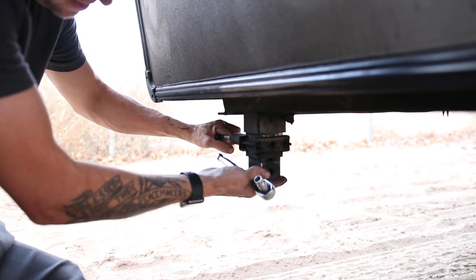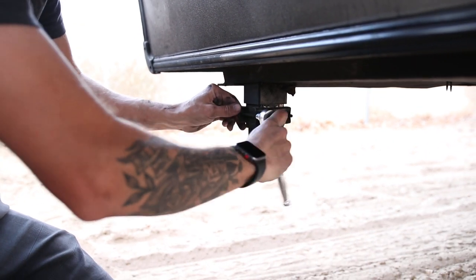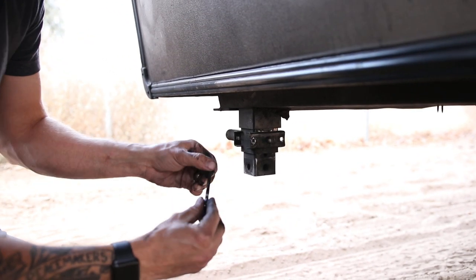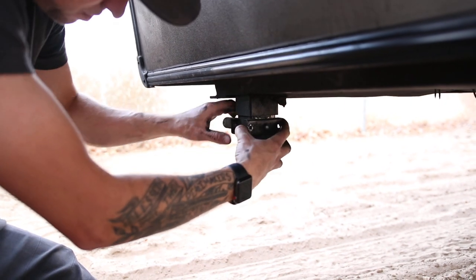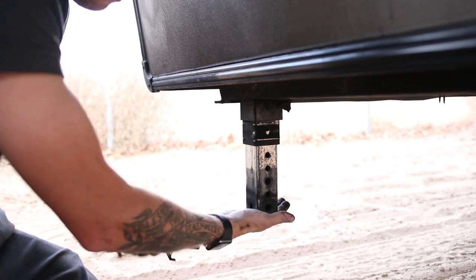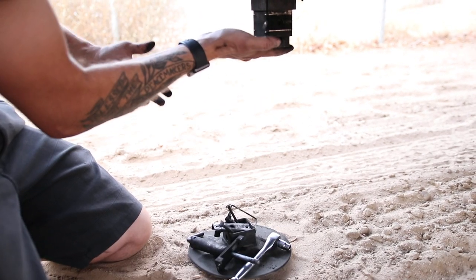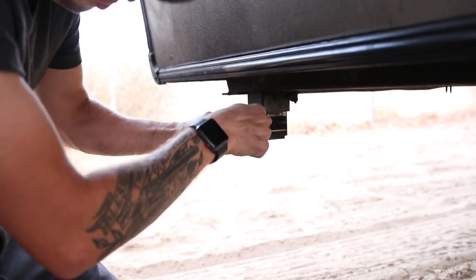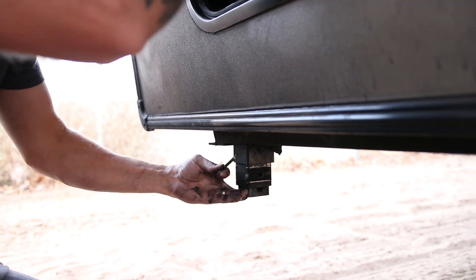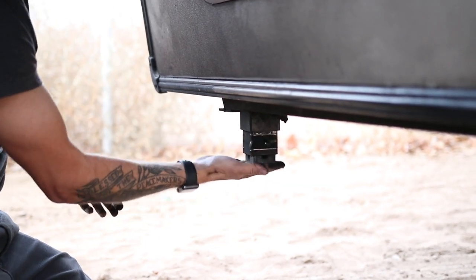Now remove the pull pin system for manually dropping your jacks — that's just two 10 millimeter carriage bolts. Use your 10 millimeter socket or wrench and set all this hardware aside, because the new unit doesn't come with this piece. As soon as you pull one side out, it's going to want to drop freely. I don't have enough room since I'm hitched to my truck to pull it out from the bottom, so I'm going to shove it back up and use one bolt to hold it temporarily while I pull the jack out through the compartment.